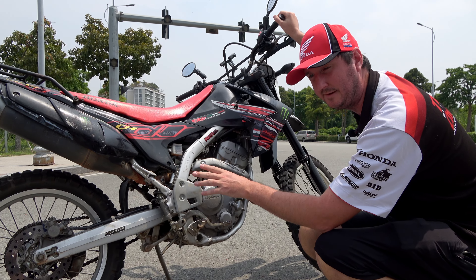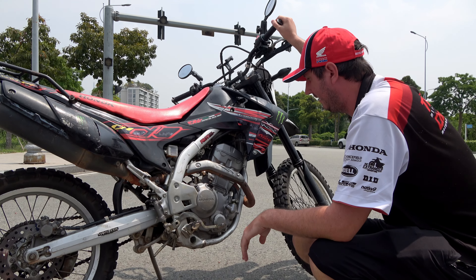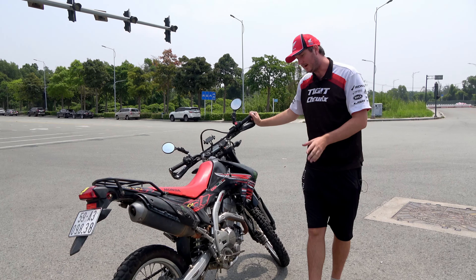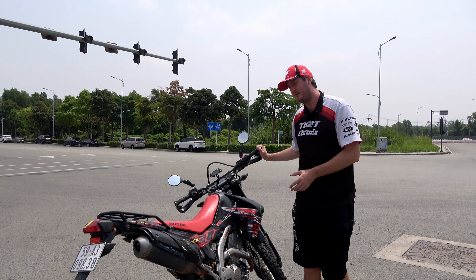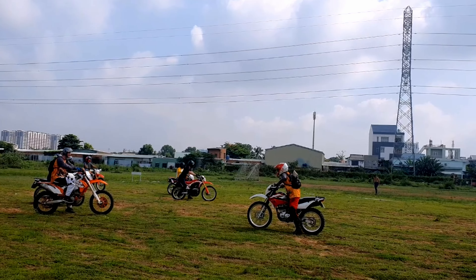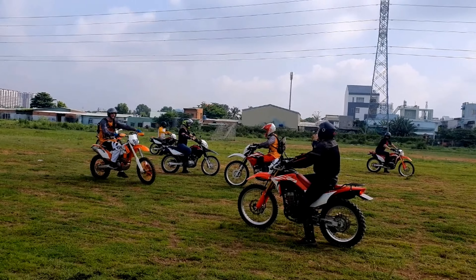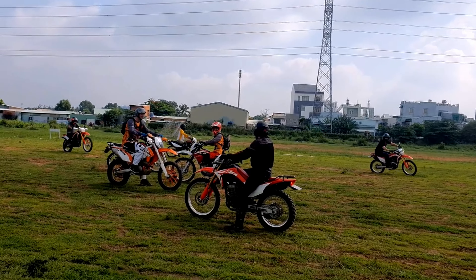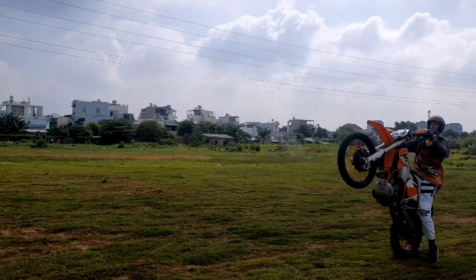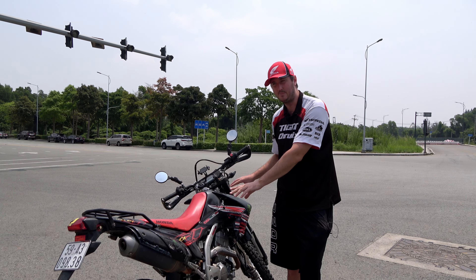So that's your daily pre-flight check: air pressure, oil, and coolant. Get those right and you're unlikely to have a disaster on this bike. The rest is just random electrical issues like the starter not working. Also, regarding off-roading — this bike is pretty good at it, but if you're trying to develop your off-road skill set you'll actually have more fun on a CRF 150 or XR 150. The power-to-weight ratio is better on those bikes; you can flick them around and wheelie much more easily. Once you've mastered the 150, that's when you're ready to move up to a KTM 350.